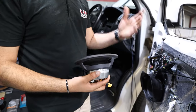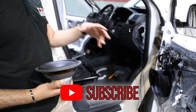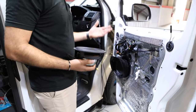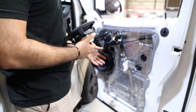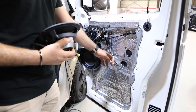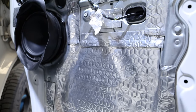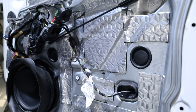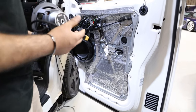It's all thought about for the long-term health of the vehicle. The window regulator might fail in three, four, or ten years — whoever needs to go into that door to service it can easily do so. We've not blocked off any grommets, and all cable clips and serviceable items are still accessible. That's why we don't cover bolts and things like that — we work around them to allow everything to be retained.